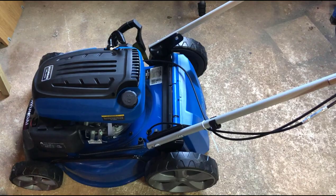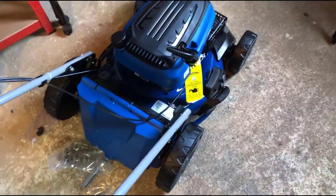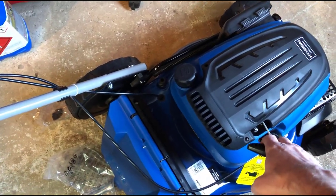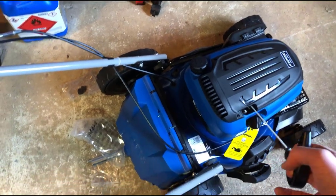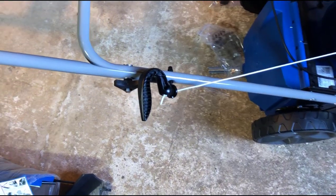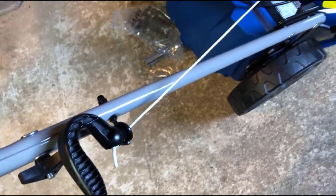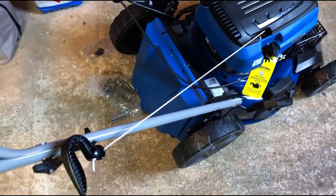According to the instructions, the next thing to do is pull the recoil lever — I think it's this one — slowly. Don't yank it, just pull it slowly. It's kind of stiff but you can feel it pulling the engine. What you're supposed to do is coil it around this recoil loop. It is a bit fiddly to do but it makes sense — you just coil it around until it catches. You definitely need two hands: one to take the strain off the string and the other just to hook it in.